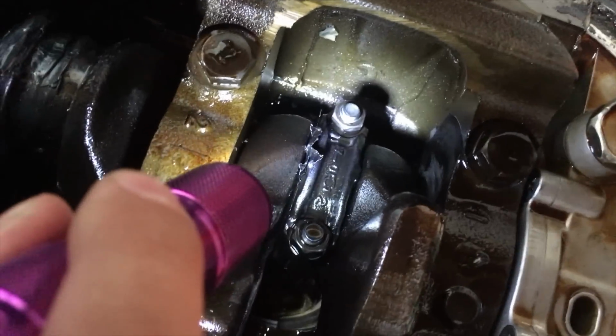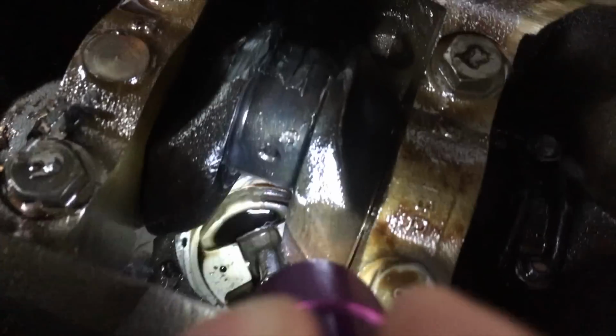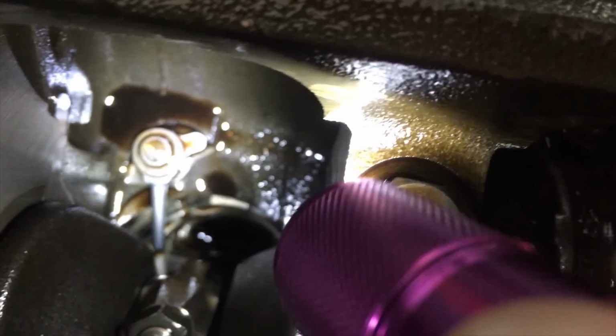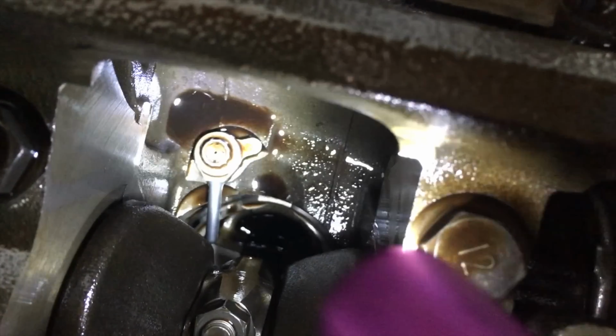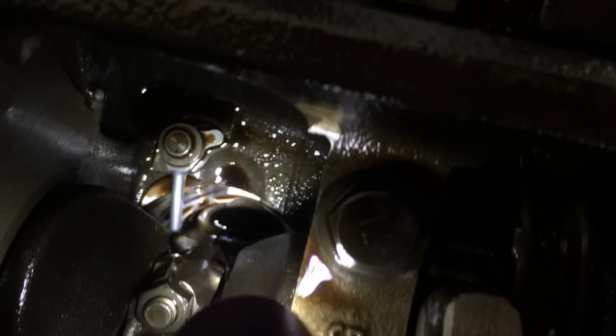Definitely need a KA. Look, you got a flap of a bearing in there. Like we said, this journal is just messed up. You can see bits of metal in here. Show them the oil squirters. Okay, so that's what a squirter should look like. That squirts oil underneath. Yeah, under-piston oil squirters. Right there, see the little rod? That sprays oil out onto it.